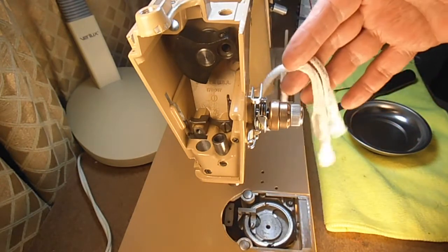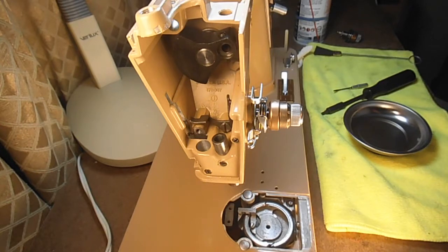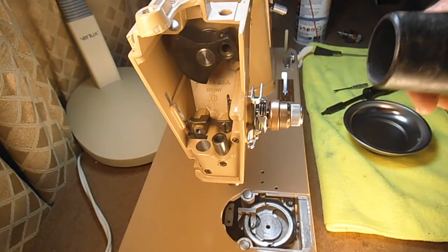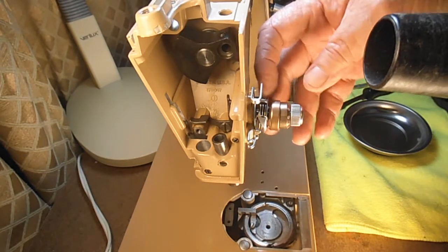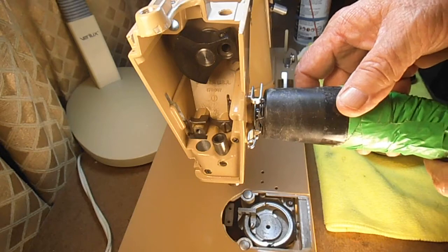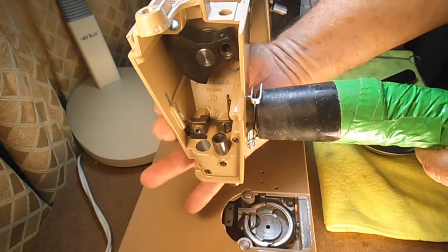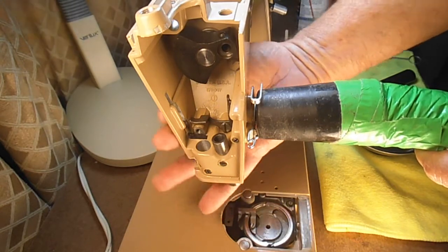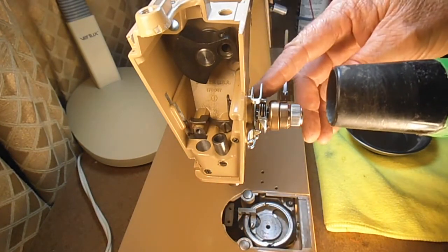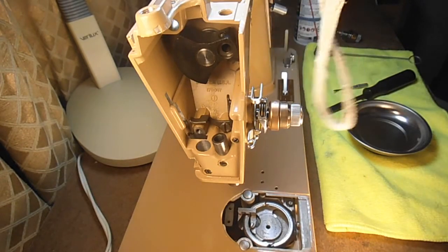But if you don't want to take it apart and check the parts and clean it, and you're in a hurry, I would rather use the vacuum cleaner hose — like the attachment hose — and raise the presser foot to release tension on everything, and gently put that on, and be careful with that spring. Don't bend the spring. Put it on as far as you can, turn the vacuum on, and then exercise the lifter lever back and forth a few times, and that will get most of the dirt and the lint out of there. Now if you have crud really built up on the tension stud, that's where giving it a shoe shine can get that kind of stuff off with the alcohol.